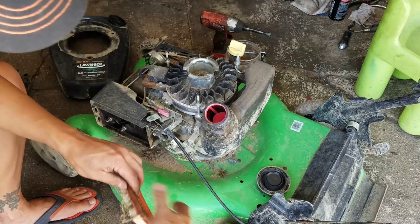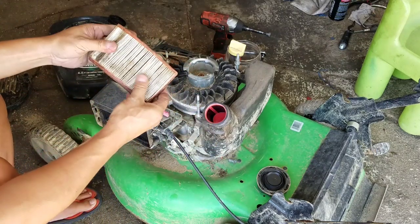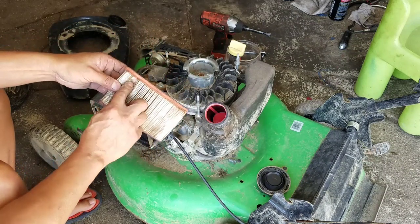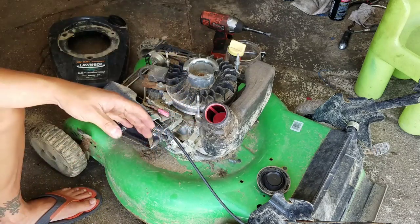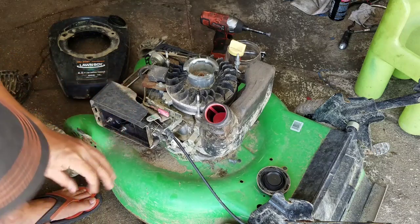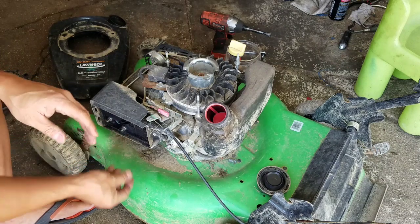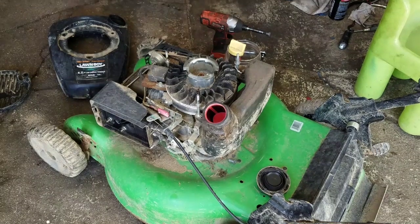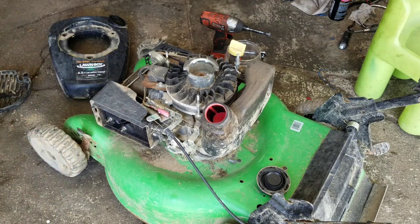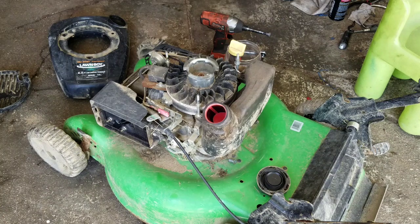It's not terrible — not good, not terrible, seen worse. You hold it up to the light, you see through it — it's good enough. I'm going to get a 10-millimeter wrench, take the nut off, just pull the bolt down to see the condition. If it's completely terrible, we have to do a full carb clean. On the Kohlers, like the Hondas, it's a pain to take apart, so I want to look at the condition of the bowl — if it looks relatively clean, we'll do a quick and dirty.